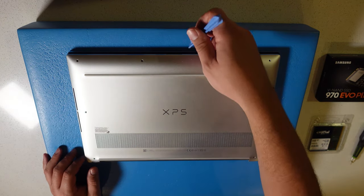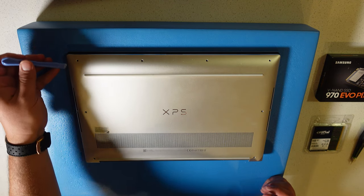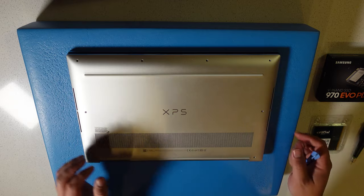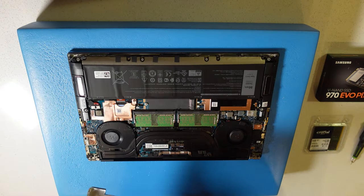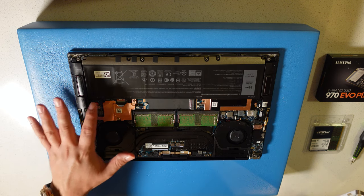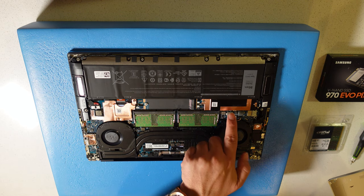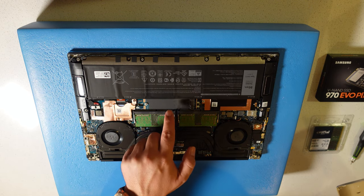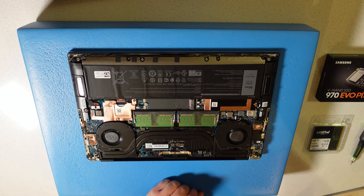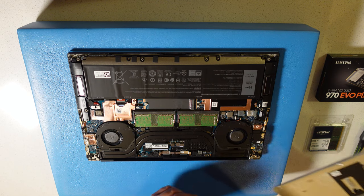I started at the power LED, worked slowly to one side and down, then to the corner edge and down — and the cover pops right off. Now everything is super accessible: you have the battery, which we'll unplug first, then the SSD slots, and also two RAM slots. I got the base setup with my Dell XPS, so stepping up to this level is going to have a lot of benefits.